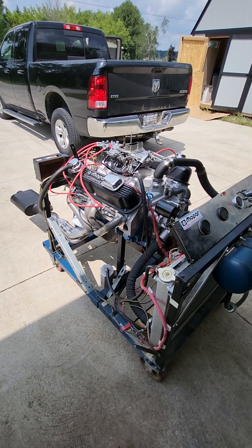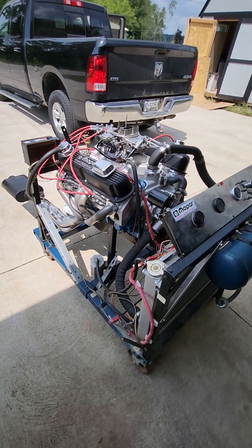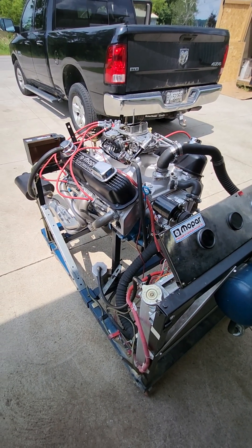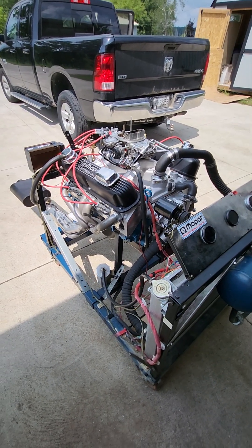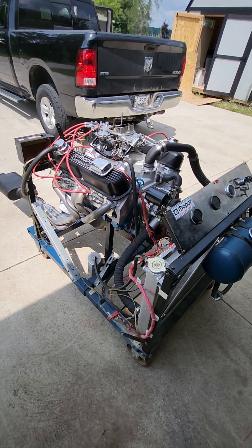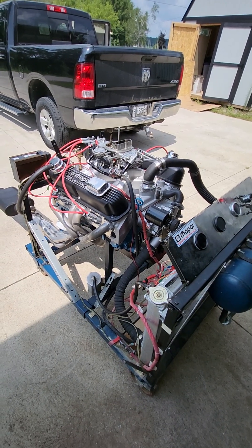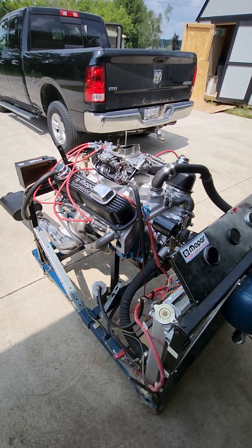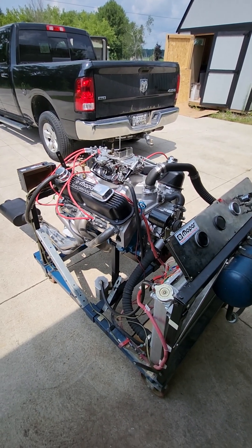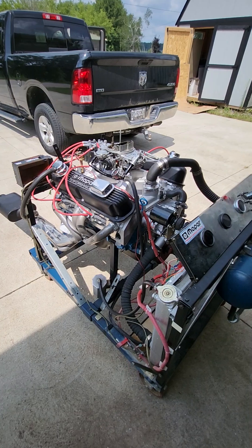It's going in his Dodge pickup truck. A bit of information about this build — I'll put it in the description so everybody knows — but it's a pretty straightforward build, similar to a lot of the ones that I build. It's got Speedmaster heads, Speedmaster air gap intake. On the stand it's got a 750 Quick Fuel carb, which I always break the engines in with, but with the deal I made with Neil he gets the brand new 750 vacuum carb as well.